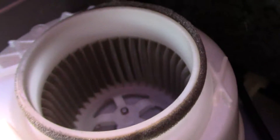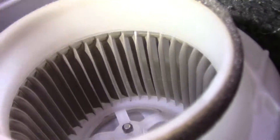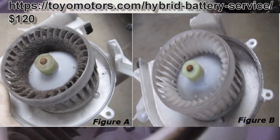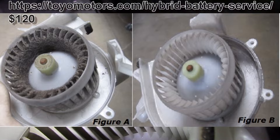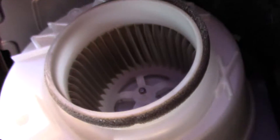This is the blower motor. As you can see, the fins are a little dusty but nowhere near the cake that a lot of other people have. If you do have really dirty fins, take your brush — but stop here: if you have a lot of gunk in there you need to use your vacuum first. Vacuum up as much as you can.